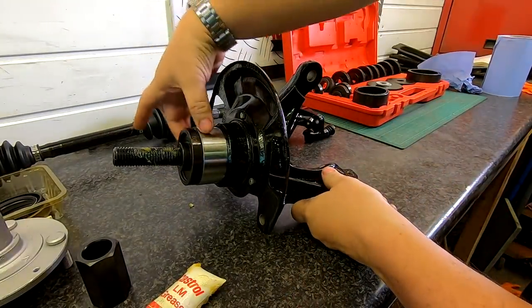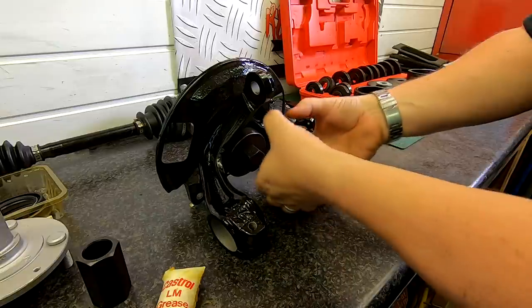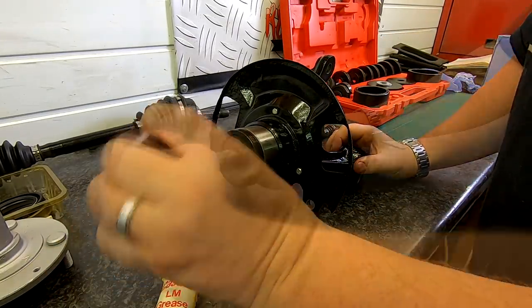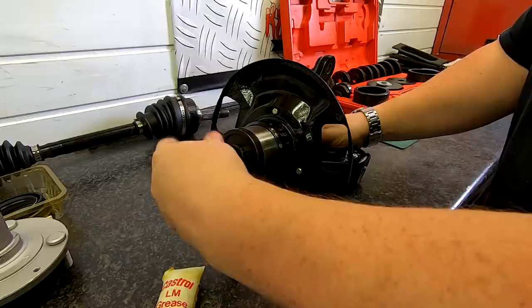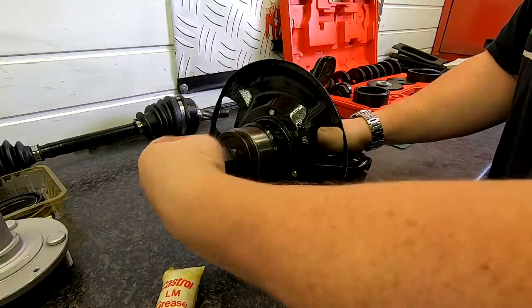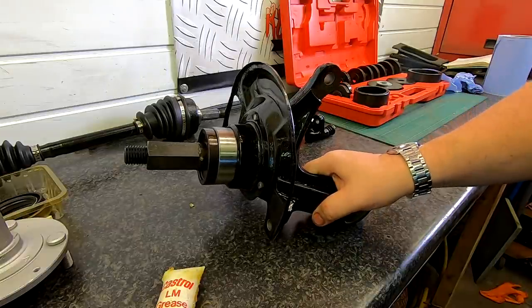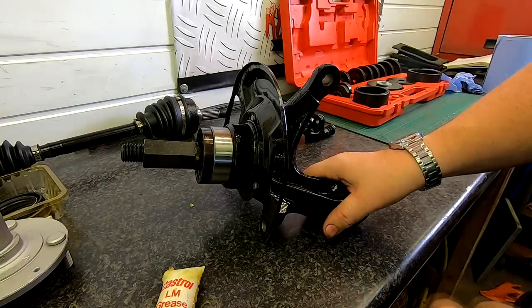The whole purpose of this is to push down on the outer race of the bearing. This cup attaches to the outer side, so it's not pushing on any bearing at all — it's pushing on the outer surface of this cast iron. So when we tighten this nut down it should pull the bearing in. I'm just taking up the tension now. It's reached a standstill there — it's gone in nice and square as you can see. So I'm going to clamp this in the vice now, and that will give me purchase to actually turn this.